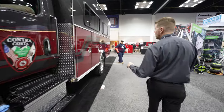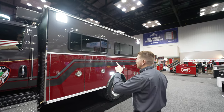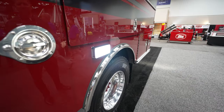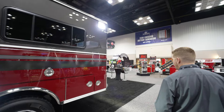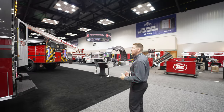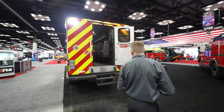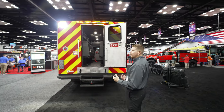On the side of this vehicle, not only are the dedicated tilted-down scene lights up top in white steady burn, but we've also given the ability for the lower warnings, just like on the side of that hood, to become additional scene lights. This is what we call our dual mode. It's because of our thermal efficiency that we can have a dual color light in steady burn white like a scene light. Normally the LEDs would reduce their intensity because of heat, but part of our patented seal is the ability to dissipate that heat with thermal material on the back of the LEDs.